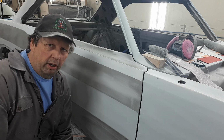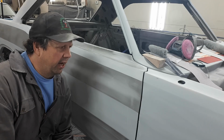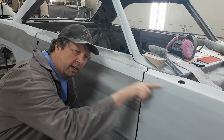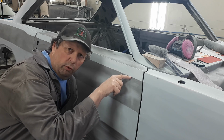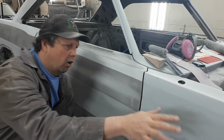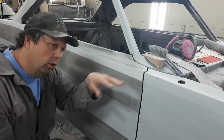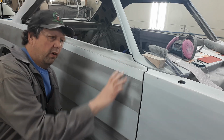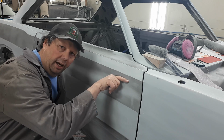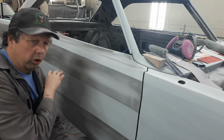When you're sanding the products, be it fillers, primers, whatever you're sanding, every stroke you have the possibility of moving that big sharp line. Every time you're sanding on this plane, you're probably going to be moving that line down just a little bit with each stroke. That's the way she goes. That's why I leave this all together like this, so if these lines are moving down a little bit as I'm working them, I'm going to move them all down. And then when I move on to the next plane, I'm going to be pushing that line back up again, and I'll carry through the whole car.